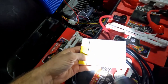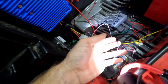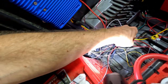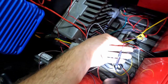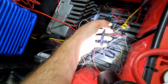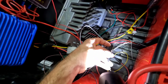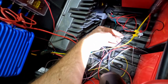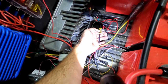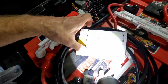The brown wire goes to the siren red wire. There's a brown wire that comes out of the module box and connects to the red siren wire. The siren has a red and a black wire — red siren wire connects to the brown alarm box wire, and the black wire off of there connects to your ground.